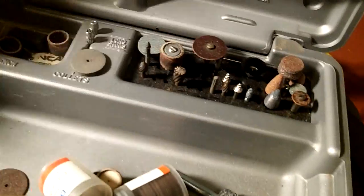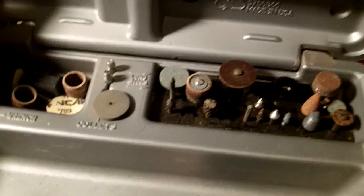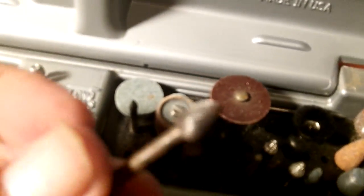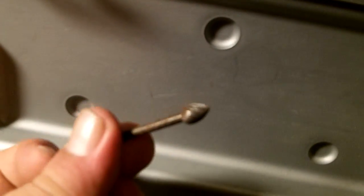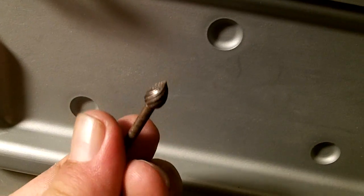One question I had is where did I get the carbide bit? Well, it comes with the Dremel kit. You can buy a Dremel tool without the kit, but I got a kit with some assorted stuff. Here you can see carbide bits — this is the one I used for porting my intake manifold. It did all four ports and didn't even make a dent in the bit. This is a great bit.